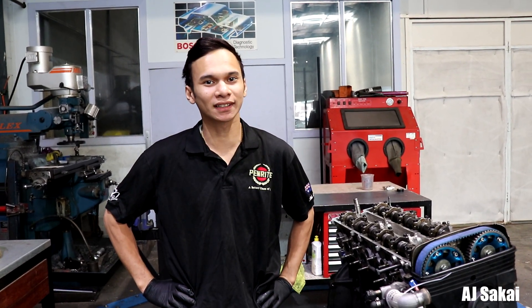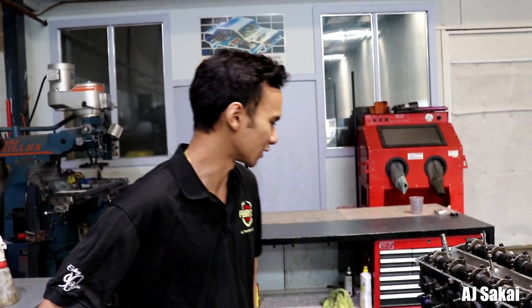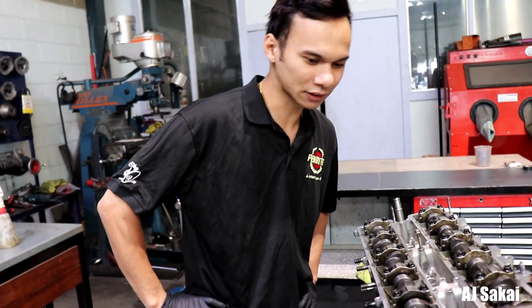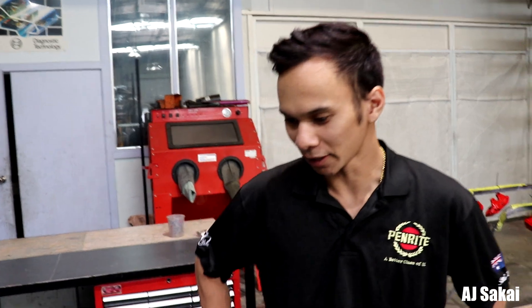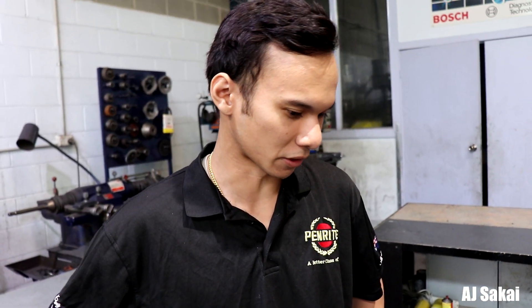I'm Derek, and this is Motor Tech, located in Neville Park. Me and my dad have owned this business for a long time — my dad's been in the industry for 35 years, I've been in for about seven. Today we're rebuilding AJ's 2JZ motor. This one looks like it was rebuilt probably 10,000 K's ago, but due to lack of oil or good oil, the conrod bearing began spinning out. So we're stripping this engine apart and rebuilding it from scratch.